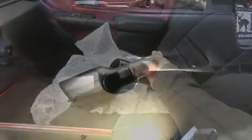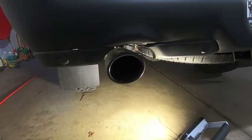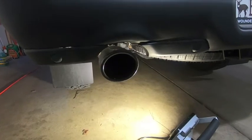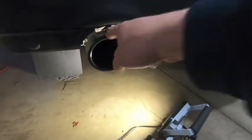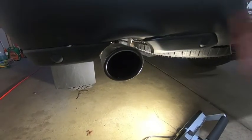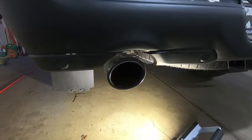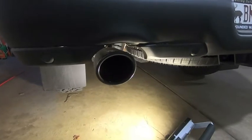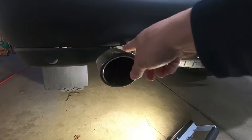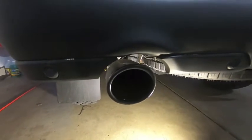We got the truck backed into the garage and it's time to start replacing the tips. This is a super easy project — filming will make it take a little longer than it would in your own driveway. You only need one tool. First tip: take an old sock and slip it around the factory tip so when you're removing it, if you bump the bumper — since it's textured black, it's more prone to scratching — the sock is there to protect it. I'm also keeping the old tips in good shape because I'll use them as winter tips and switch back in the summer.